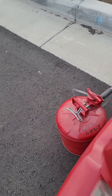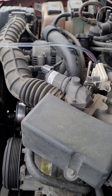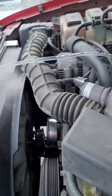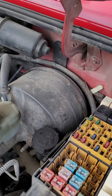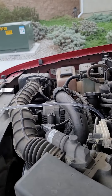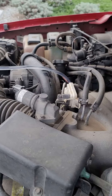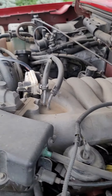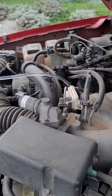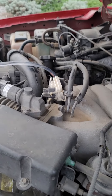It starts right up. Take it out, disconnect it — you can see there's air in the system starting to purge. Put it back, there we go. Just make sure you keep an eye on it because you don't want to burn out the fuel pump or overflow and make a mess. Thank you for watching.